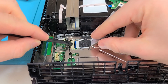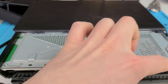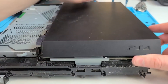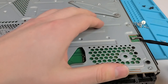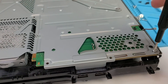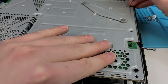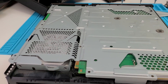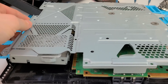Now we can disconnect this cable by pushing down on this little metal thing and then pulling out the cable. We're gonna unscrew all these guys and then we're gonna lift up this part too. Sony added their own little touch to their screw. Now we have to remove all these screws. So my PS4 is pretty clean — if you haven't cleaned it ever, wear a mask or something. Be prepared to be absolutely disgusted with yourself. It's nothing personal, it's just these things get really really dirty. Okay, we got all the screws out, now it's time to lift up this thing.